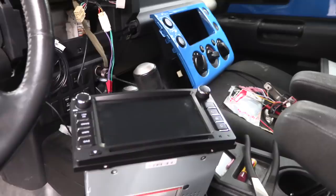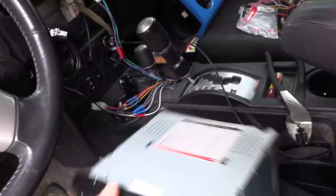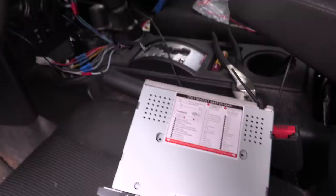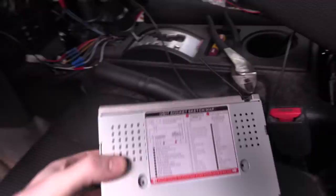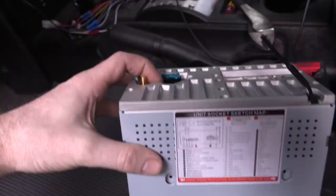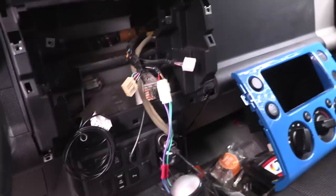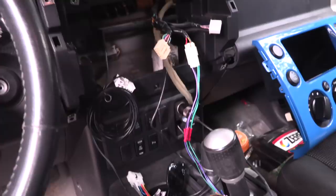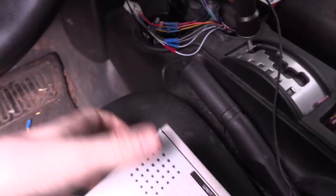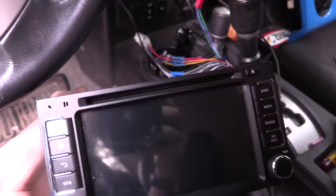We were off to a great start and then all hell broke loose. We installed it once and were able to power it on, but after the next time I went to power it on it never worked again and started screwing up my car. After hours of diagnosing I found out this system has a grounded circuit - once we sent power through it fried one of the circuit boards. Now the power wire that runs in is also connected to ground, so any time you plug in this stereo - on or off, powered or unpowered - it will blow the fuse in the car. No link in the description for this one.